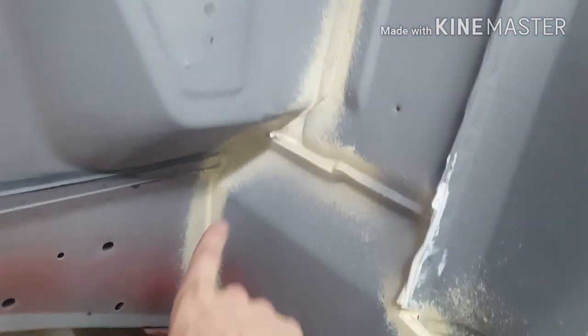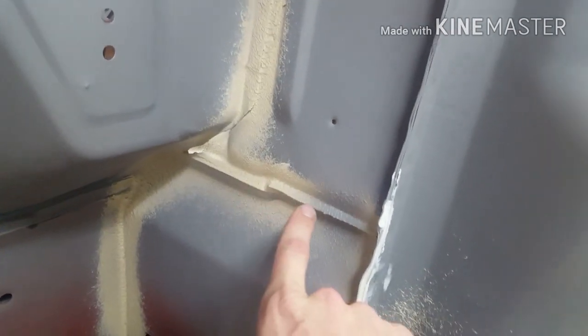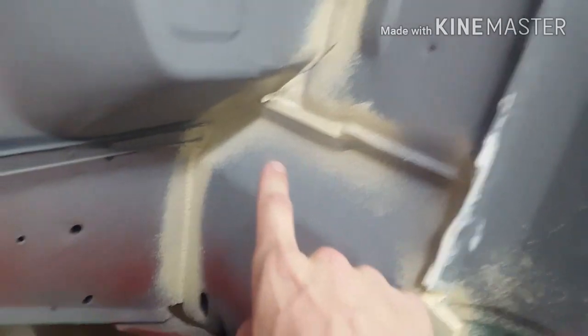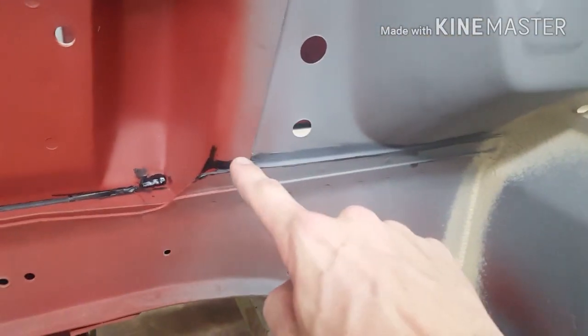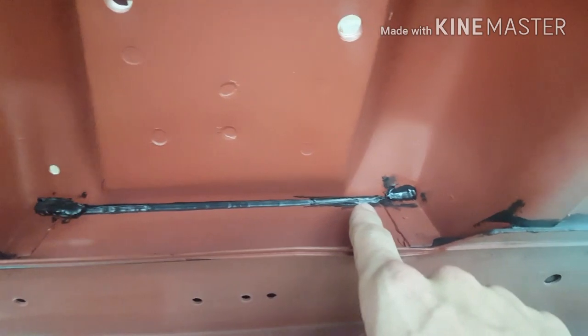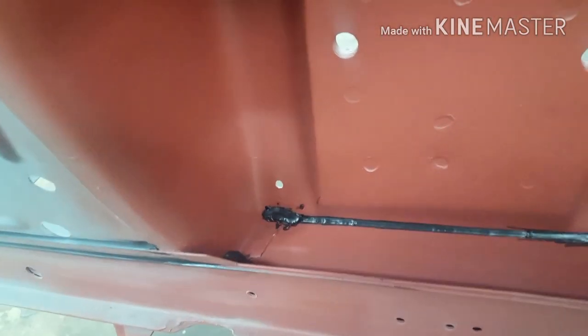And then we seal these seams. Same as in the trunk, I actually filled that with seam sealer first and put the spray sealer over the top. Down there. Normal sealer just in that gap there. In the bottom here, same thing, sealer along there. And these had like balls of sealer in the ends. Tried to replicate that look the best I could. Now when we paint this, with the black down, we don't actually paint as much inside the shock tower. Get the black overspray in there. You'll see this later.